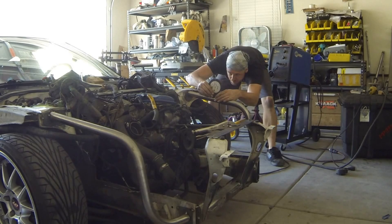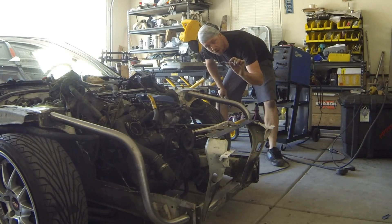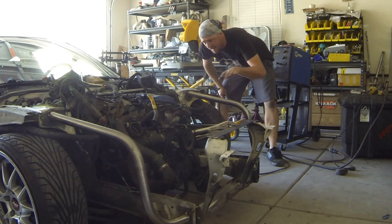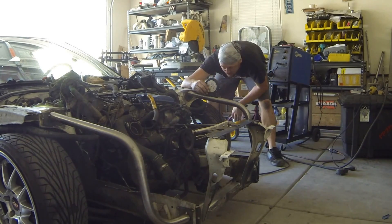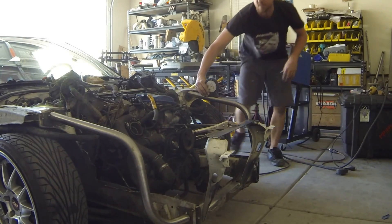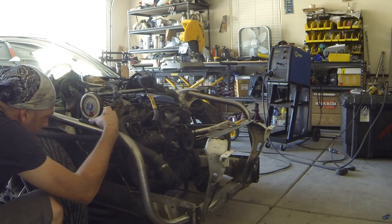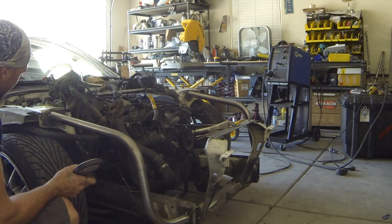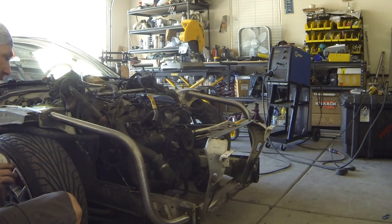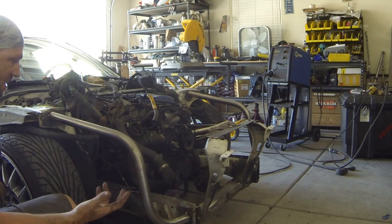I ran my measurements just a few moments ago and realized that this tube right here was actually a quarter of an inch too low, so I had to lift it up just a little bit, re-tack, re-weld and everything. Now it's set in place — I have it measured out correctly for length, width, and height. I just need to make sure the angles on both tubes are exactly the same. I've got eight degrees on this one, which is right in line with that fender where I wanted it, and I've got eight degrees on this one too. There might be a fraction or a tenth of a degree off, but that's not a big deal. Tubes are in place, everything is basically balanced out and sitting correctly — I'm satisfied with it.